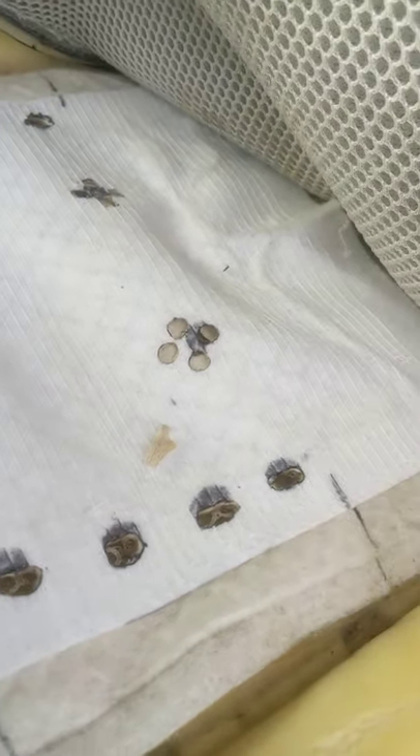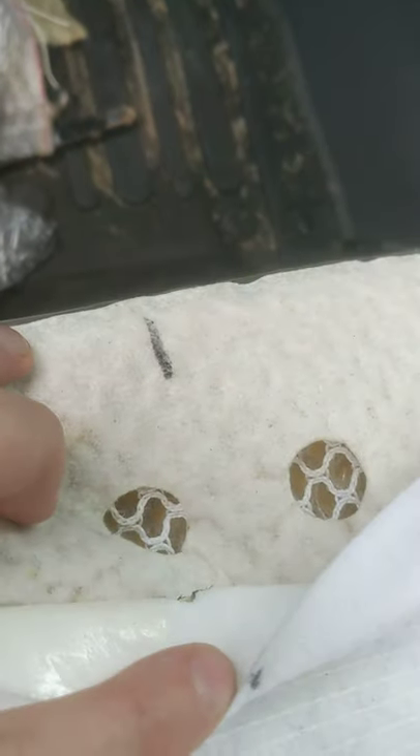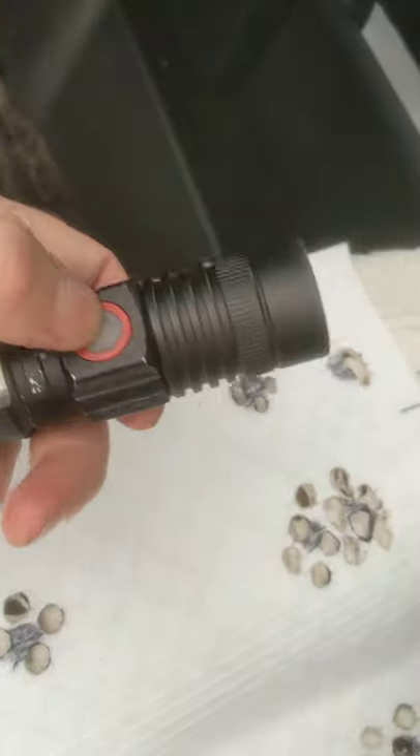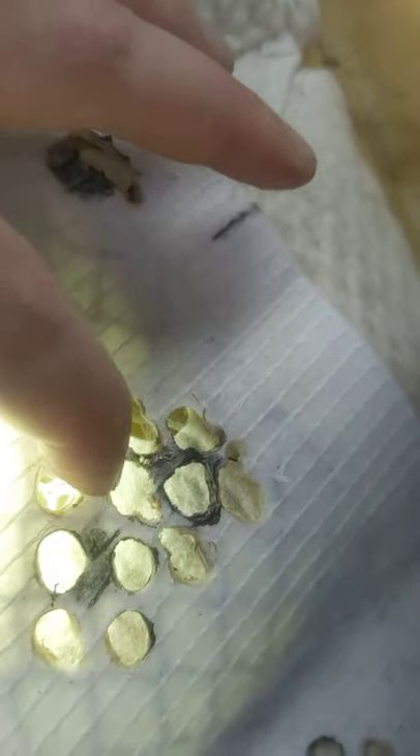Once you get that cut off, I used the entire pad. If you've got air-conditioned seats, take a flashlight underneath and you can see that netting back there. What I did is I took a soldering iron and poked holes through it, making sure I did not cut the wires. I accidentally cut one wire, but luckily it still had connections. Just make sure you cut all of the places where the holes and the vented seats are.